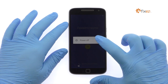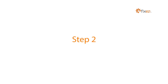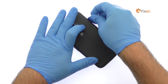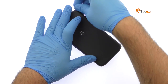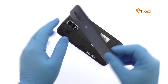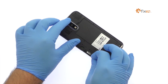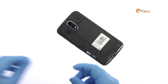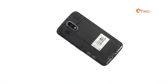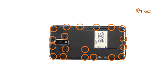Power down your Motorola Moto G4 Plus smartphone. Use the plastic triangle opening tool or your fingernails to work around the Moto G4 Plus rear cover and release the plastic clip securing it in place. Remove both nano SIM card trays. Remove the following 19 T4 Torx screws.